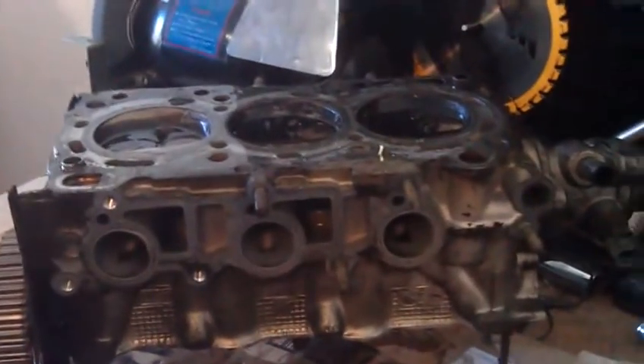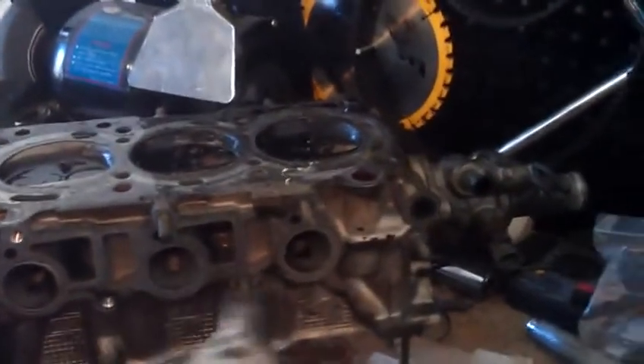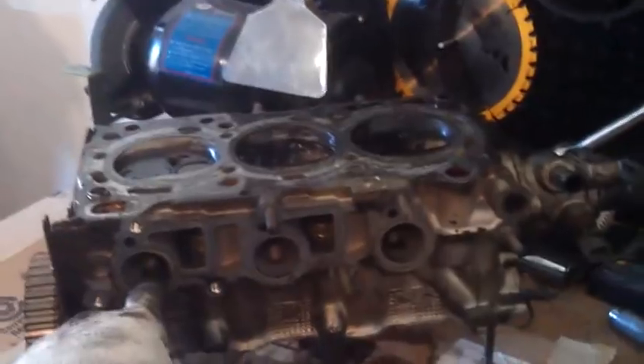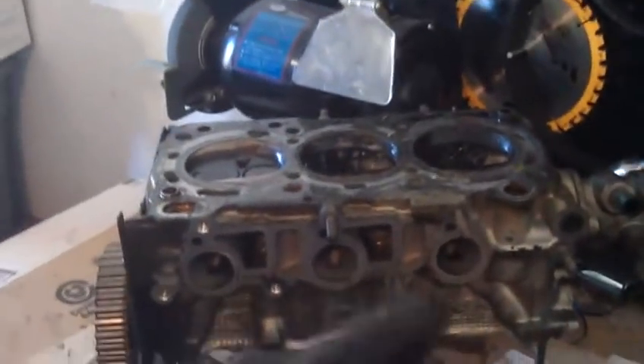On the other side are the intake ports. There is no leakage whatsoever in these intake ports. It's very rare that an intake port will have damage unless you've got a timing belt breakage or something like that, which would cause the piston to collide with the valve. It's 10 times more common for the exhaust valve to have leakage because you have the hot exhaust gases going out that exhaust valve all the time — that's its job, that's its purpose. So it's by far more prone to leakage.